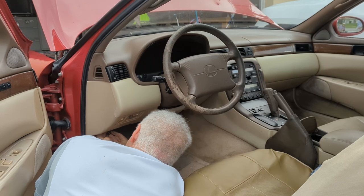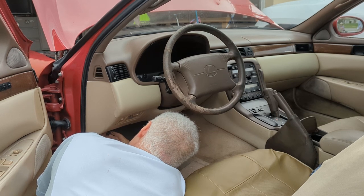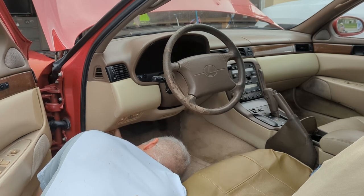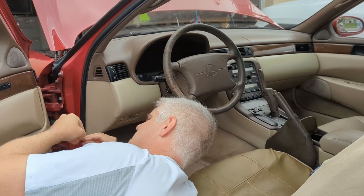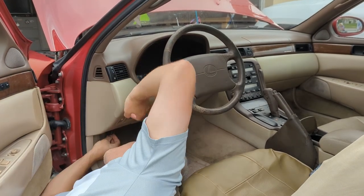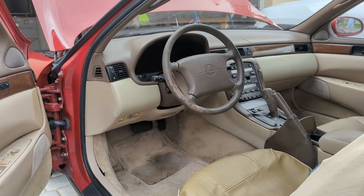So if you're looking at the connector, all the way in the bottom right pin is TE1. The one to the left of that is TE2. The one to the left of that, so three in from the right on the bottom row, that's E1. So I'm going to short the second pin in to the third pin in on the bottom right. It's really tough to see though. Probably need 20-year-old eyes to do this. Really tough to see. Sorry about that. All right, I think I got it.